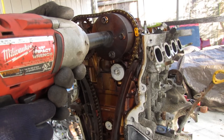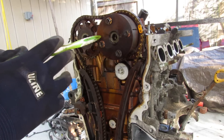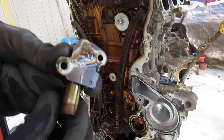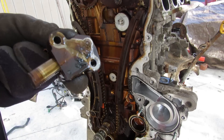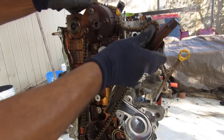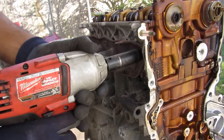I'll loosen the cams before removing chain tension. Interestingly, the VVT gear uses a pentagon socket rather than a standard hex — a kind of security measure to discourage tampering. To release tension I remove the 10mm bolts holding the tensioner, which is hydraulic with small holes that push the plunger against the timing chain slide. At 300,000 miles the plastic chain guide is still held up well. The chain, slide, and VVT gear can then be removed. The exhaust manifold is very simple with tiny runners suited for an economy car.